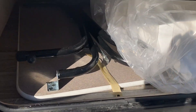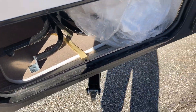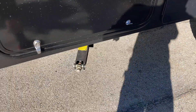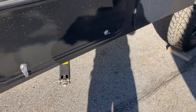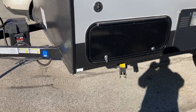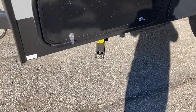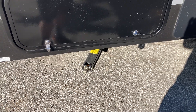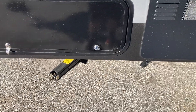You have a storage compartment up here with a little door hold-back. Your dining table right here is a foldable table so you can have it outside as well. You have stabilizer jacks on each corner — two in the front and two in the back. To level the unit: put tires on the block first, unhook from your truck, then level it front to back with the front tongue jack. Then crank the stabilizer jacks down until they hit the ground and give it another half to three-quarters of a crank to put a little pressure on it.